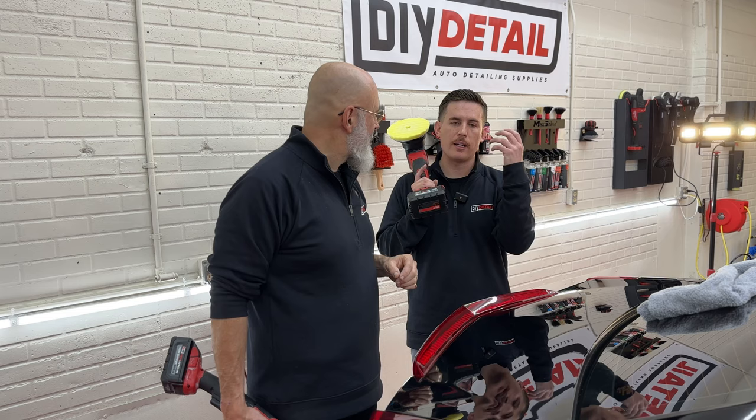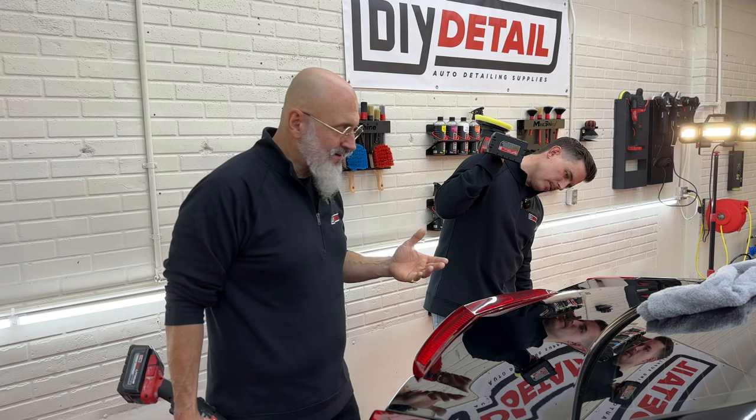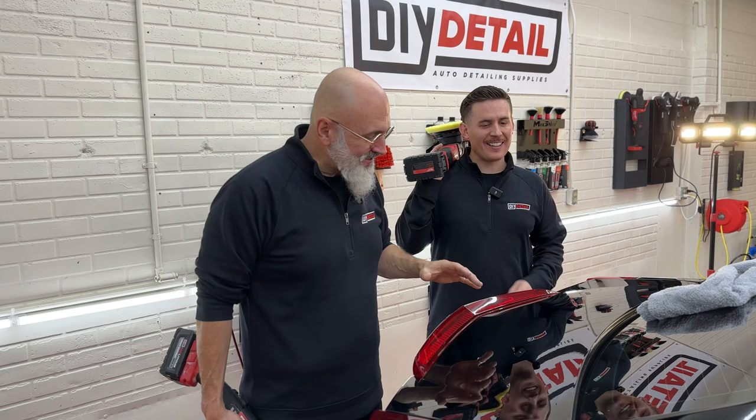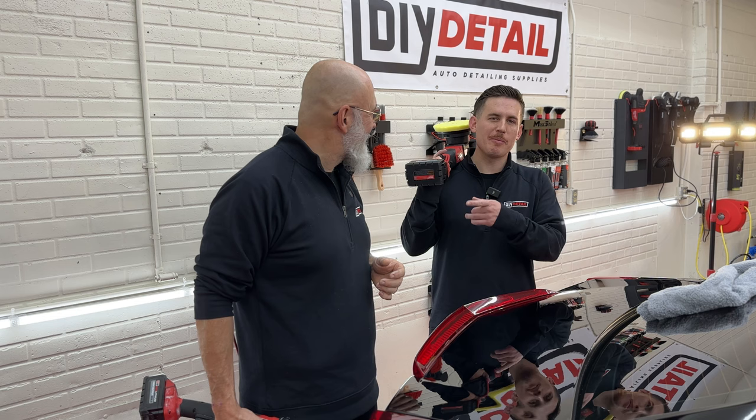Yeah, and for the rotary, again, it's not difficult to use. It's not dangerous. It's not gonna drag you all over the place. You saw I was barely holding onto it. It's glossier. It is, yes. He's gloating. He doesn't believe me. No, he's gloating. I'm not gloating. I've been trying to tell him this for years. But anyways, the rotary is not the big, dangerous axe that everybody puts it out to be. For me, I actually cut with the DA. If I'm doing a two-step, I'll cut with the DA, but I'll always finish with the rotary. I think that I'm the opposite for now. Ivan might convince me one day. This is pretty convincing right here.